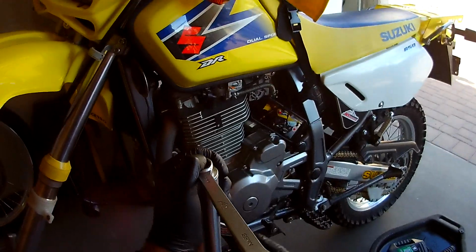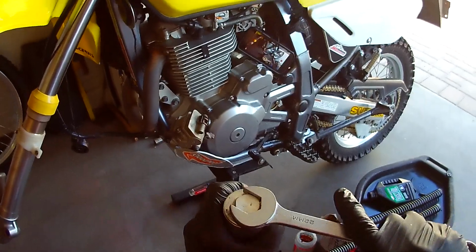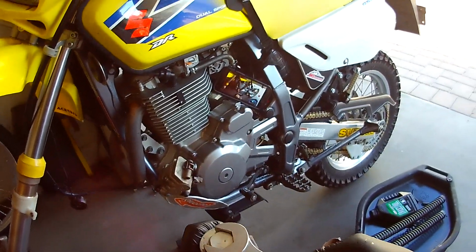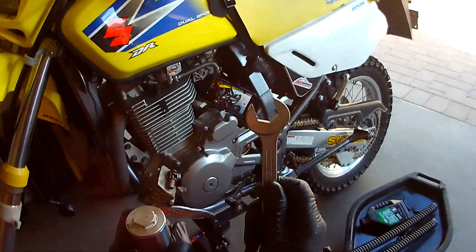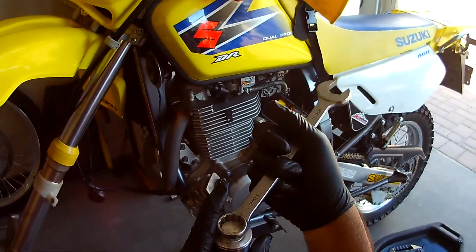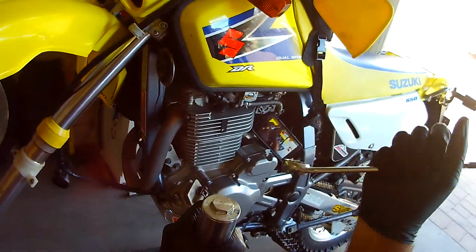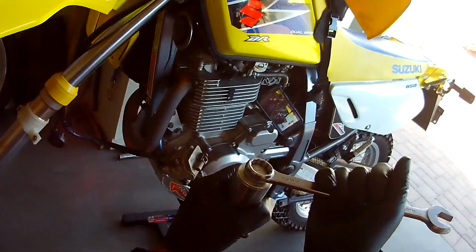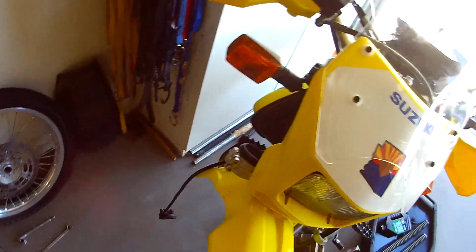And I see guys on YouTube, they'll be doing like this, you know, as they're tightening, and that's okay. I think you have more of a chance to mess up this nut. This is a Mac wrench. I love these things, but most of your wrenches don't have the extra grip in the corner, and it's actually better if you use a 6-point. But yeah, I would say use the box and you get a little bit more grip, but that's just my preference. But I do see other guys just using the open end of the wrench, and it just doesn't look proper.